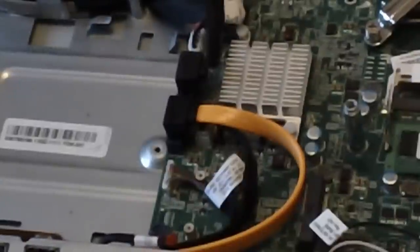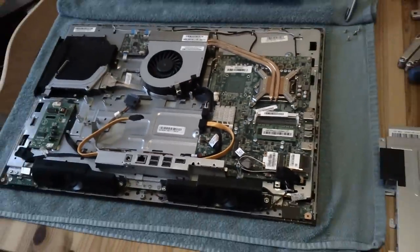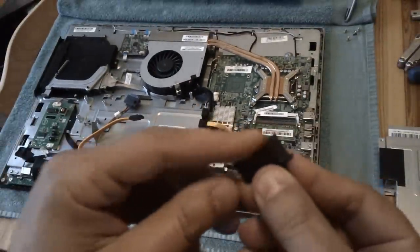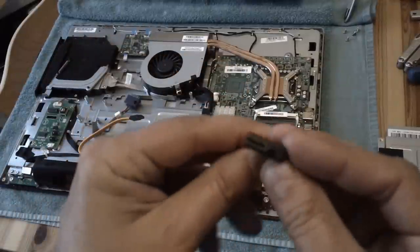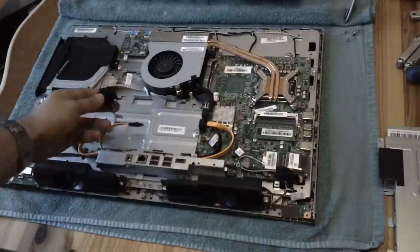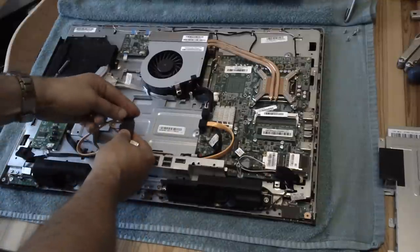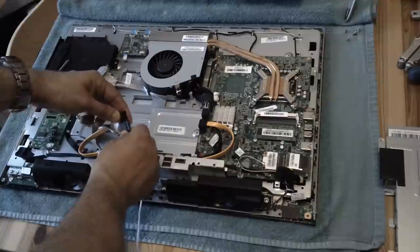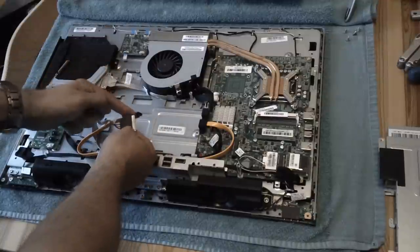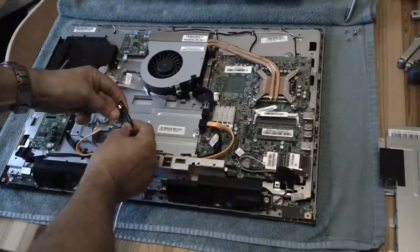You don't need to snip it off, get a SATA power cable and solder it back on - you don't need to bodge or mod a cable. What you do is use a Dremel - you simply take the big cable and cut the data bit off, leaving you with just the power connector. Then you try to fit it to a drive - it's going to be quite a tight fit, so you keep trimming, scraping, grinding bits off until the two cables fit.